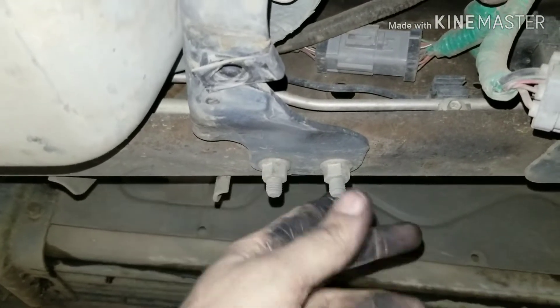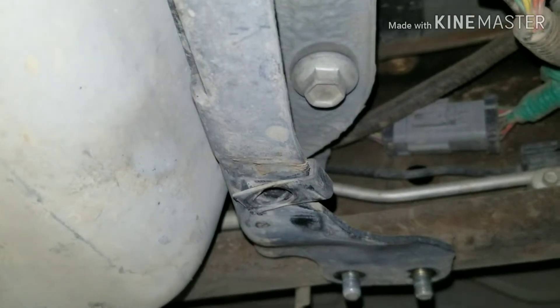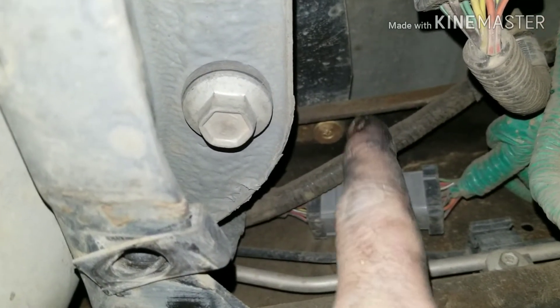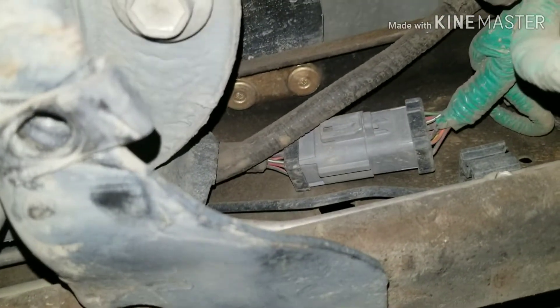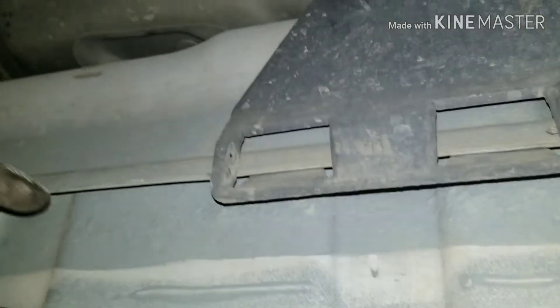After you get your tank drained, go ahead and take off these nuts — I should say your tank drain, not your fuel pump — and then take this bolt off. You want to have this supported; you can put a jack underneath. Take the clamp things loose and slowly let it down so you can have better access to your fuel lines and electrical connectors. Watch out for any hoses that can break off, usually towards the back of the fuel tank. On this bracket there are two bolts, and there are also two bolts on top that need to come off before the studs come down and the fuel tank drops. Once those are out, it moves freely — go ahead and let it down.